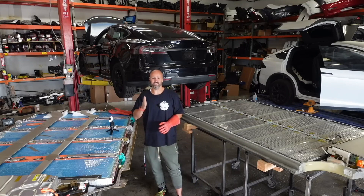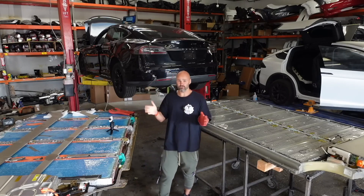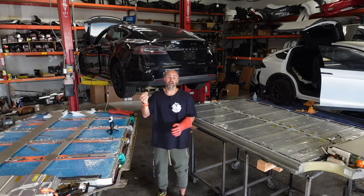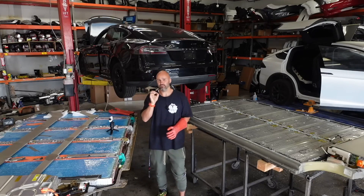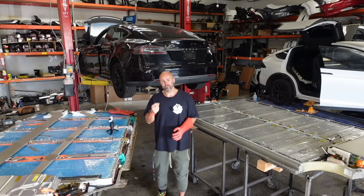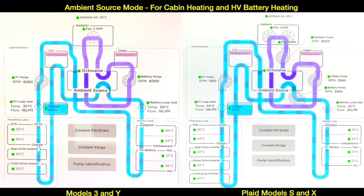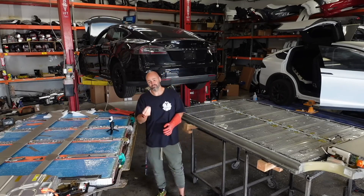Most Tesla batteries are designed to last around 10 years, regardless of the amount of driving or distance covered. Even if you drive a lot, it will still last 10 years — it degrades a little more, but literally just a few tenths of a percent. If you initially have a 100% battery, after a couple of years you'll have about 97%, and after 10 years of heavy use it should still be more than 90%. Both of these batteries have cooling systems, and that is literally the most important thing that sets them apart from your phone batteries — because batteries in iPads, MacBooks, and phones do not cool down, and because of this the lithium deteriorates and dies.